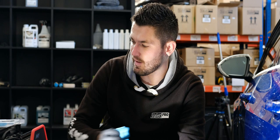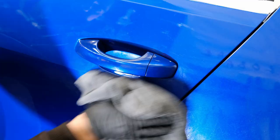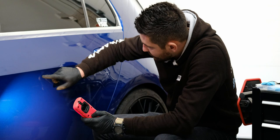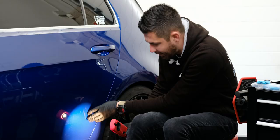I'm going to grab one of my clean cloths and just wipe the residue of the clay rider off there. As you can see there are lots of swirls, deep scratches, and I imagine this has been painted at some point — there are wet sanding marks and holograms. So we're going to just do a masking line down the middle. There's a bit of marring in there from the clay bar but that doesn't matter too much because we were going to polish this anyway. There are lots and lots of different defects in this paint.